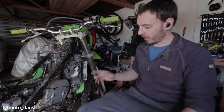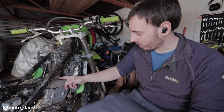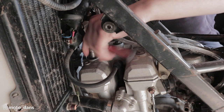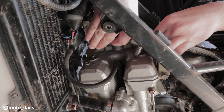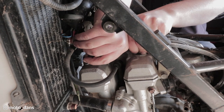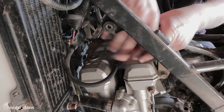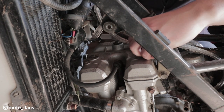I've got the fuel tank off. We need to remove the valve cover which is just three 10-mil bolts. We'll remove the spark plug and then the two timing plugs on the other side. I did give the bike a good clean before I took the tank off, just to make sure this whole area here is nice and dirt free - we don't want any dirt dropping inside the engine.